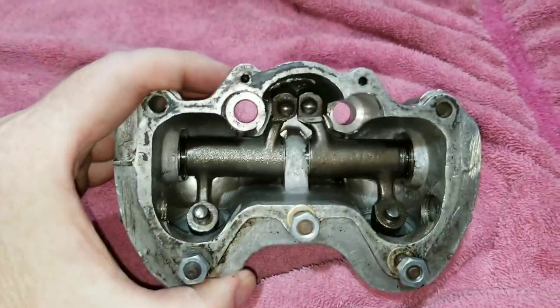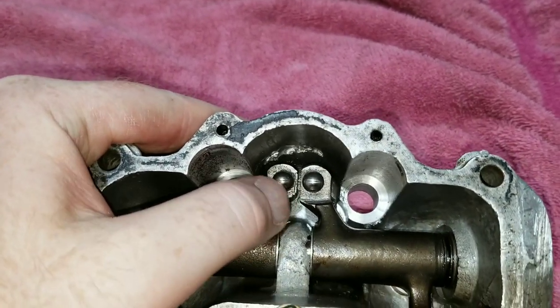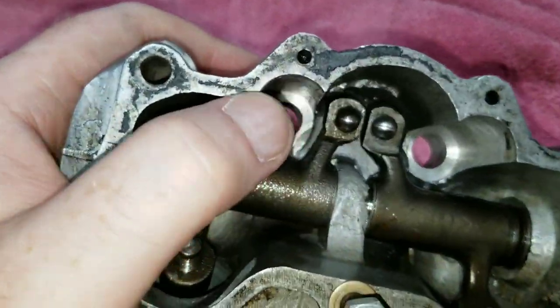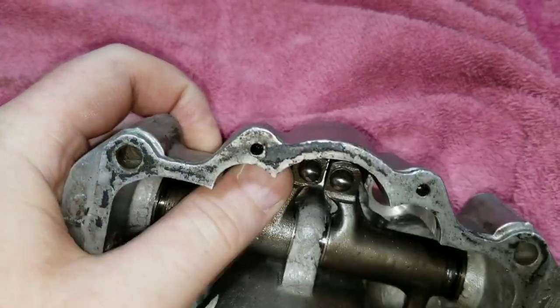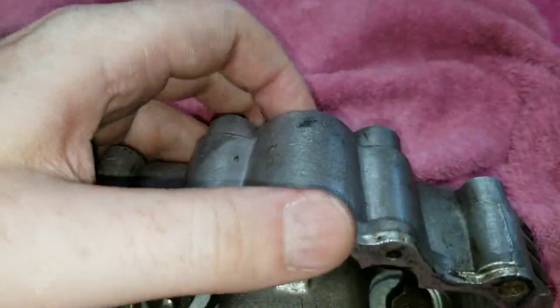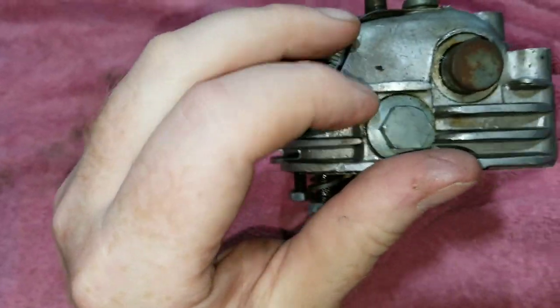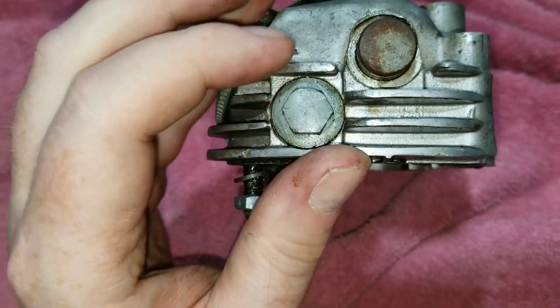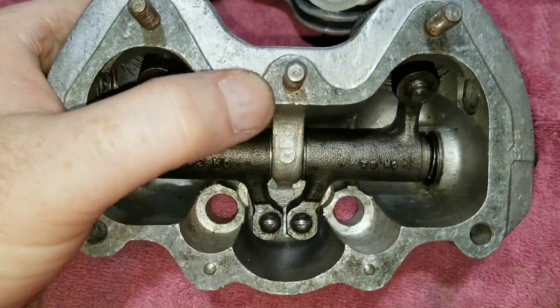On this Tiger motor, the rocker boxes were all damaged from the push rods not being seated on the balls properly. When they were gouged, I also found later that these actually have cracks right here where they mount and tighten down to the head itself. So we had to get different rocker box covers, and we wanted to keep the 71 style. We came across a nice set at a swap meet earlier this spring.